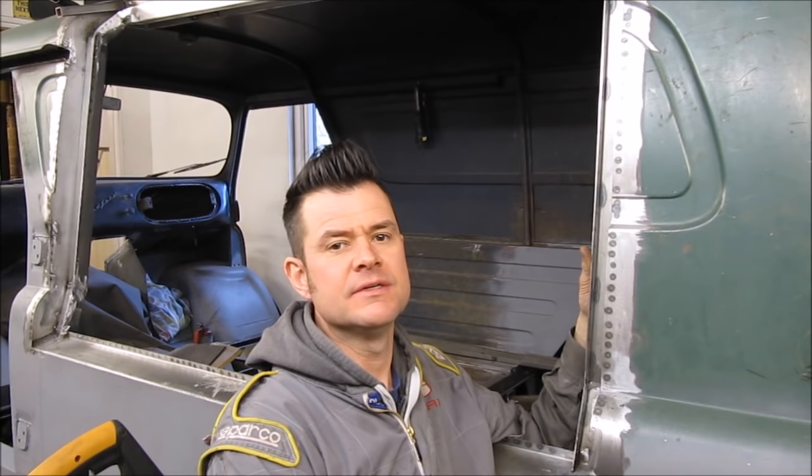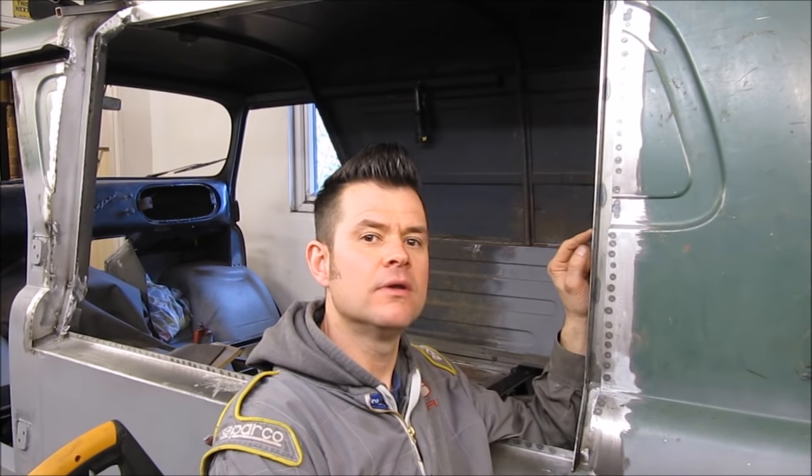Aperture completed now. Next thing I've got to work on is making a framework that's going to fit this aperture that I've created. Now, we've already talked about the internal gutter to take the water away. The gutter that takes the water away has got this lip on it. Now this lip will hold a seal. And when the door shuts against the seal, it will form a seal that is compressed.